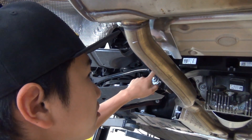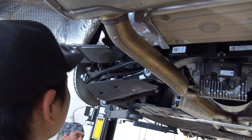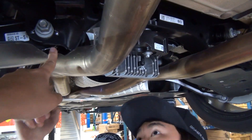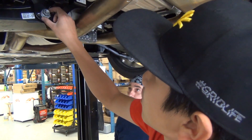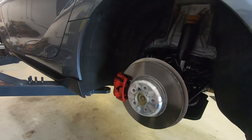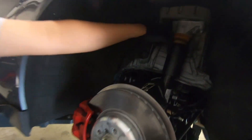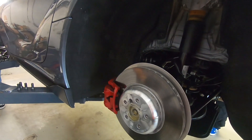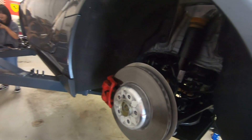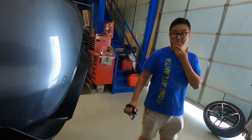There is camber adjustment — a little bit. Most of the BMW rear is all kinds of adjustable. Is the front adjustable? No, it's probably just toe. Oh, that's a toe arm and that's actually camber — it looks like we can get a little more camber in the rear. From experience, the rear suspension setup has about 90% similarity to a Mini Countryman, how the suspension bolts up. It's BMW, but that can be a good thing.